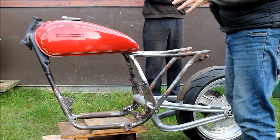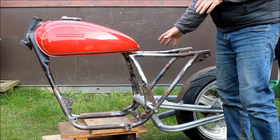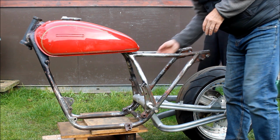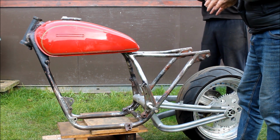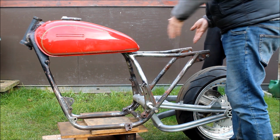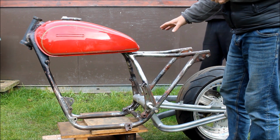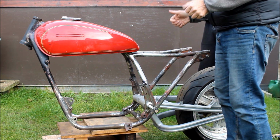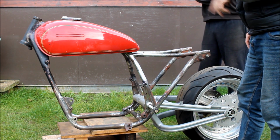And now I've decided to do that with this tank and so on. What we can now do is finish off the bracing on this frame. So now we can put a cross piece here, which would be behind the carbs. Have you decided what, with a tube? I'd rather have a tube myself. Yeah, a tube will look good. And once that's done, we can start thinking about making a box, I'm not sure alloy or stainless steel, to go inside to hold a battery and electrics. The bike's going to have, just like other bikes, a Motogadget m-Unit because they're fantastic. Really like them, they're very small and they make the wiring so much simpler. So that's what's going to happen.